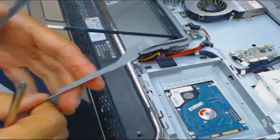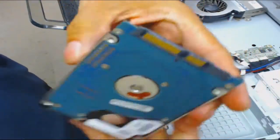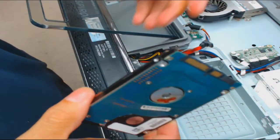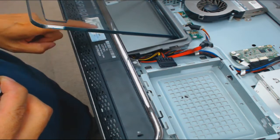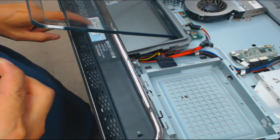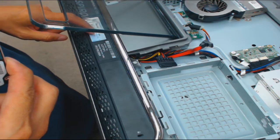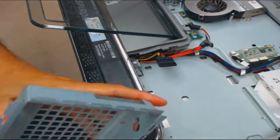The mounting bracket comes right out - I'll save that and return it to her. Now it's just a standard SATA hard drive. I'm assuming this is a good hard drive. Before I load Windows 7, I'm going to restore this computer. I don't have the factory recovery partition, but it does have the sticker - you do not need to buy a new copy of Windows as long as you have a legitimate Certificate of Authenticity sticker and the product key hasn't been used on another computer.